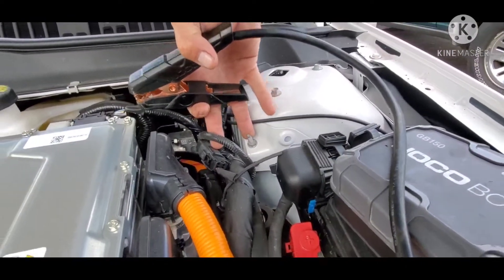Just like this customer — he lets the car sit, he doesn't drive it as often as he should. And so the batteries tend to go bad in about a year and a half here in Florida. Just make sure you start these cars up and drive them around and get those batteries cooking a little bit, so to speak, so they get mixed up and they last longer.